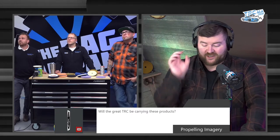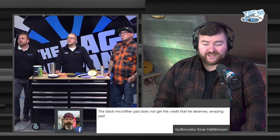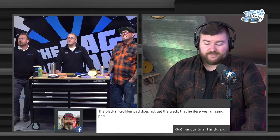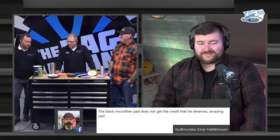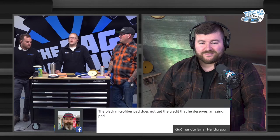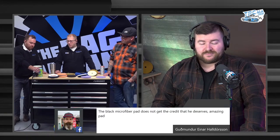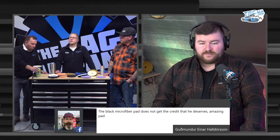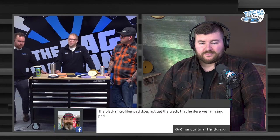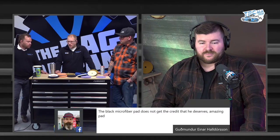Yep, and I've got a couple more here. One's a note from Gumi. Wanted to say the black microfiber pad does not get the credit that it deserves. Amazing pad. You are 100% right. And I would say most people finish with foam. Foam is something that people traditionally finish with. The black microfiber that we have is a true finishing pad. It's not a polishing pad. It is not very aggressive, but it does finish phenomenally well.